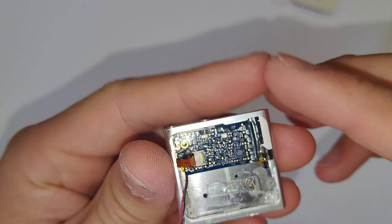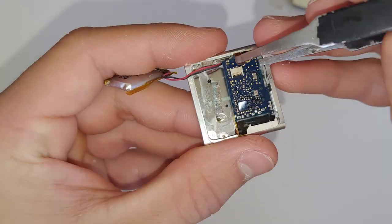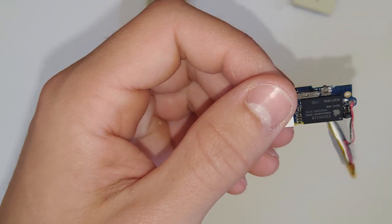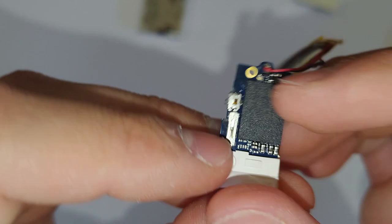In order to take that logic board out, there is just that little white bit of plastic there under the headphone jack, so just remove that as well. Don't lose that piece either, because again, every time you put the headphone in, it'll push the whole logic board in. To remove the logic board, just get some tweezers, put it in the headphone jack and push it back a little bit, and then it should just be able to slide out just like that.